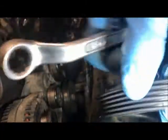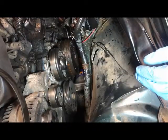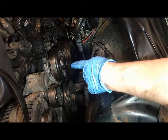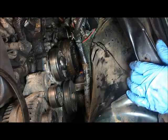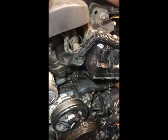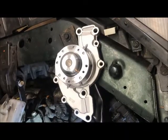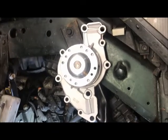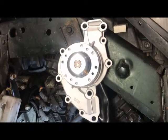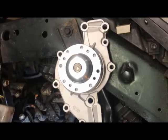We will check the belt for cracks, and if so, we're going to replace it. The pump is now in clear view. I believe there will be some coolant spill underneath — if the radiator has a plug, drain it from there; if not, just have something to catch the coolant. Make sure the car is cold so you don't burn your hands. Here is the new pump — always look at the new part and try to see if it matches before you take the old one off, and also to get an idea where all the bolts are.